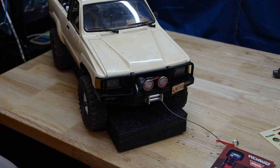Got all that fitted up finally. They must make those CC Hand bumpers out of steel from Wolverine's poo, because I couldn't drill through that. I was lubricating the drill bits. I have a pretty good set, they're cobalt coated, and yeah, that was some solid stuff. So I had to start way small and kind of work my way out to keep biting at it. And it finally got some holes drilled in it to mount the new winch.